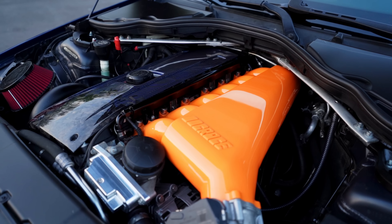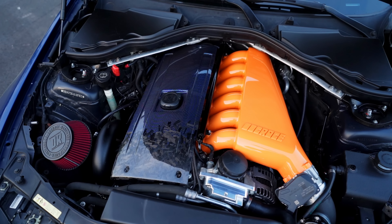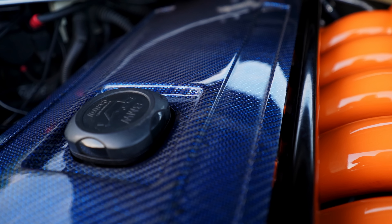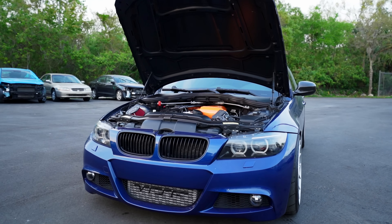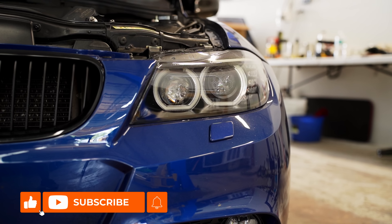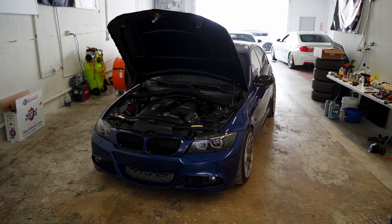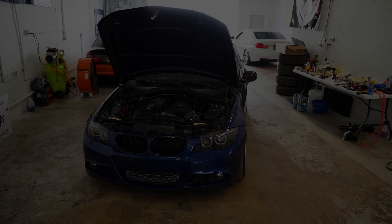The BMW 335 seems to be running pretty good, but occasionally it has its moments where it starts to smoke a little. At this point, my only guesses are the turbo is starting to fail or one of the piston rings — the oil ring — went bad. Should I go with a built motor? I think this car really deserves it. Let me know in the comments. Like the video if you enjoyed it — it really does help out the channel — and subscribe so you know what ends up happening next. As always, thanks for watching. Till next time.